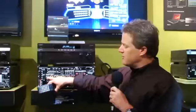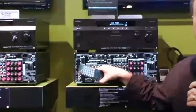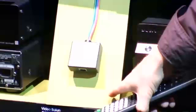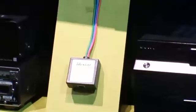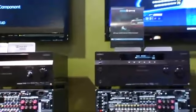One of the first things in the industry is that this receiver actually has a CAT5 output for a second zone application. I can use this MuxLab video balun, which is a specifically designed component balun made for Sony by MuxLab for our receivers. It has an amplified circuit and allows us to increase the distance of running CAT5 and component together. This is one of the first receivers that allows you to run CAT5 straight to the receiver and run component video out to other zones.